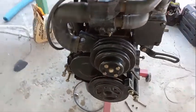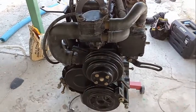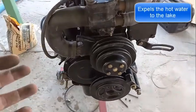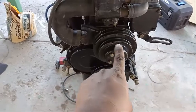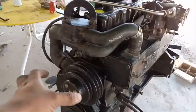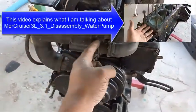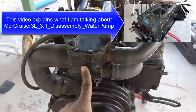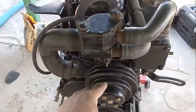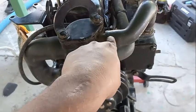As I've covered before, this engine doesn't have antifreeze — it grabs the water from the lake, but at the same time it expels the water. So this is the way it typically flows. This is the water pump; it pushes the water into the block and it goes around the water jackets. The water goes in, it goes up the heads, and then comes out through a port right here in the heads. At that point the water has a decision: it can go back into the engine, which warms it up even more, or it can exit the engine right here.